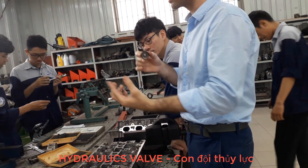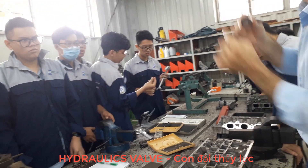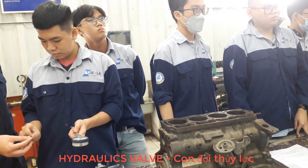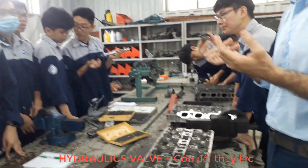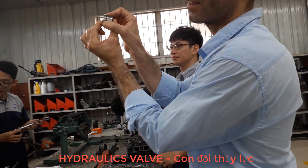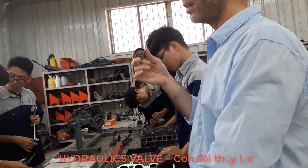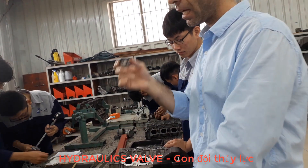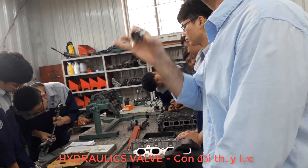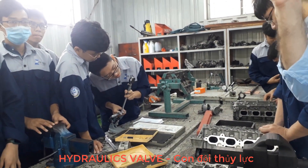So when the gap gets smaller, it affects the operation of the valve — the valve will be open. Every millimeter is important; every millimeter in the engine is important. So this will adjust the gap. It means lash — between the valve and the camshaft. The camshaft and this have a gap, so this will adjust it.